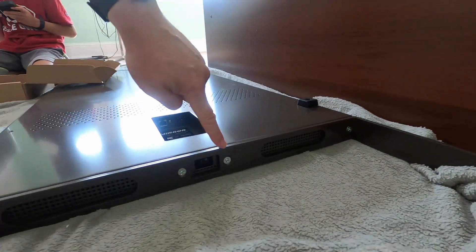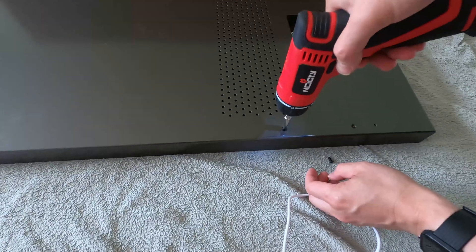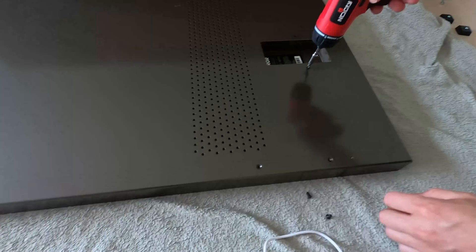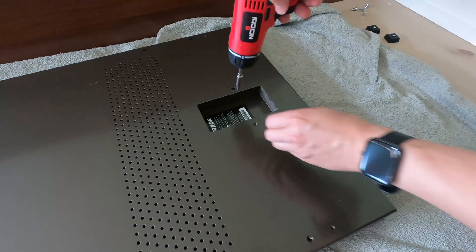Replacing the motherboard is relatively simple. Down on the bottom, assuming that you have the mirror stand, all you have to do is release four Phillips screws. Next up, there are several more Phillips screws — release them all. It can be pretty time consuming, so I'm just going to use a cordless screwdriver.